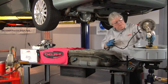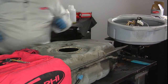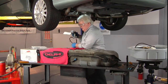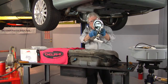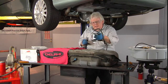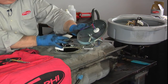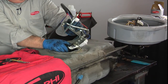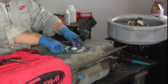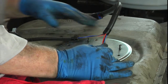We'll catch any residual drippings from the hanger pump, grab our new unit, and reverse the procedure. Remember where those arrows are lined up and where the fuel line connection was. We'll put the arm in first, compress the strainer unit, and slide it on in, letting it snap down exactly where it was. Then put the screws in and torque them to spec.